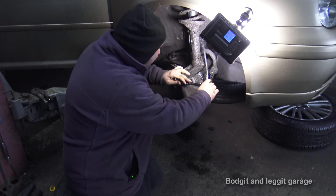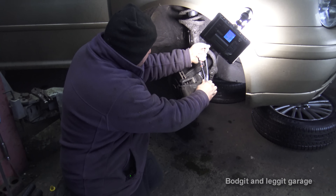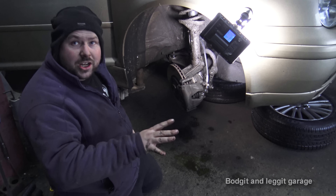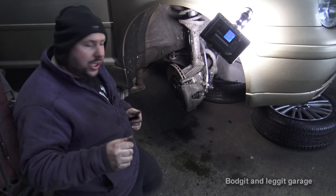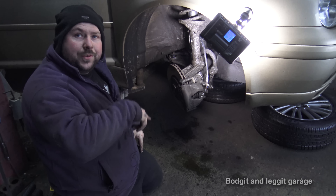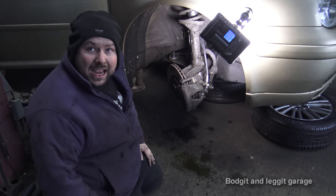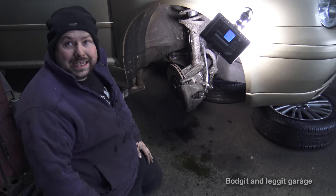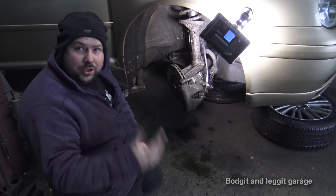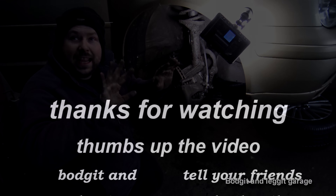Right, this is going to be the last time. That's it — now we should be bled. Pump it — solid. That's gone solid straight away, which is a good sign. What we do need to do is turn the engine on, put pressure on the pedal, and make sure none of our joints are actually leaking — top it up with fluid too. If one of your joints is leaking, just tighten it up a little bit more. But that is essentially how to fit a flexible brake line and bleed it. Hope it helps — thumbs up, subscribe, and don't forget you can follow us on Facebook and Instagram, links down below. Most importantly, get your hands dirty — see you for the next one.